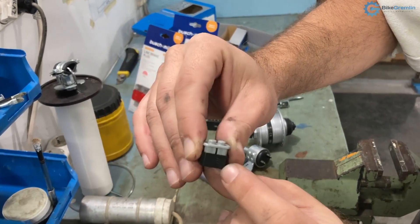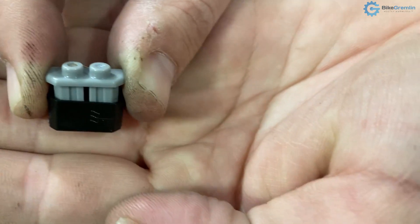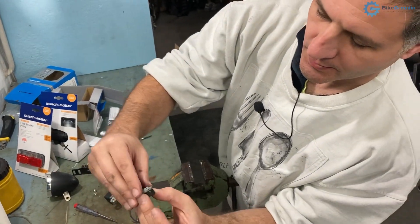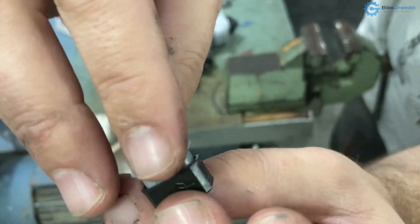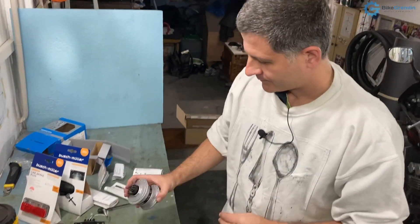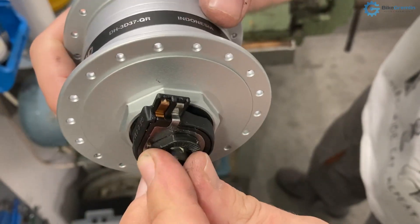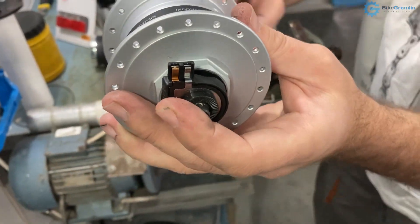Here it has a marking for the ground wire — it's marked with this sign. That wire you can use your bicycle frame for, and the other wire is important to route all the way to the rear light. The system is marked on both the back side and the front side so you cannot miss it. The ground wire on the outside is connected to the frame through the hub and lock ring, so generally you don't even have to route that wire.